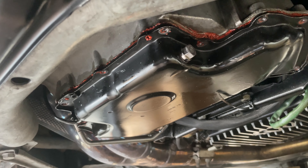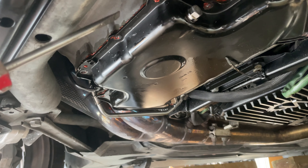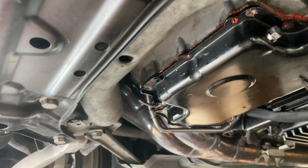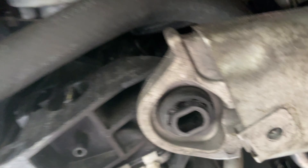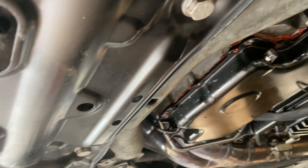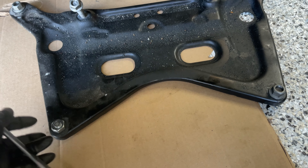I got all the T30s out. Right now the lower oil pan is only being held up by the RTV which I smothered in here. Obviously I'm going to clean this up and do it better this time around. I'm just going to use my trusty screwdriver pry bar and slowly and deliberately pry this down just a little bit to break that seal, and then we'll have exposed the bottom of the lower oil pan. Next, we're going to take off the subframe brace bolt, the bolts that hold the power steering rack up, sway bar, control arms — and same on the front, do the control arms there too and the sway bar. It's not too involved, just making sure we do it correctly.